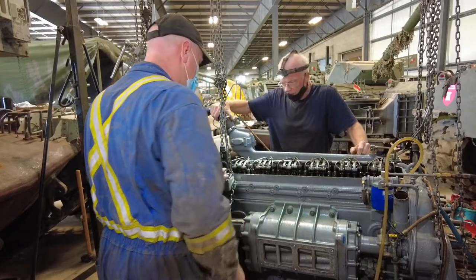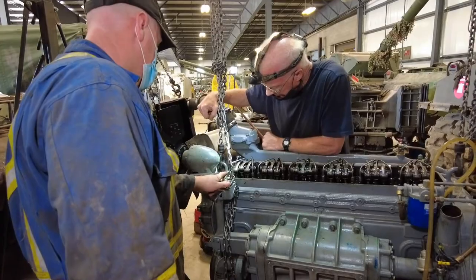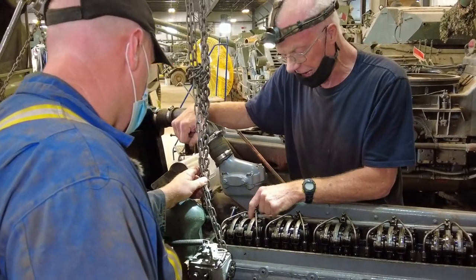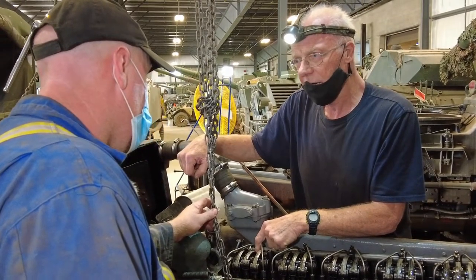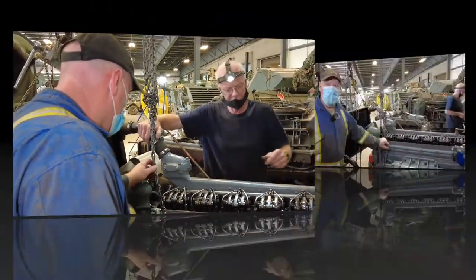Pull an injector. What else can it be? I don't think it's air in the system. I think the fuel knock died down when this one was closed. It's not injecting — there's something wrong with it. It's not atomizing, it's not atomizing and burning properly.